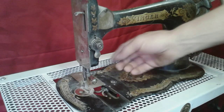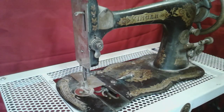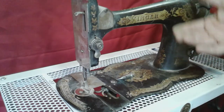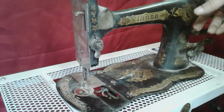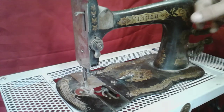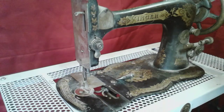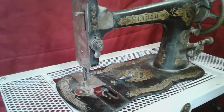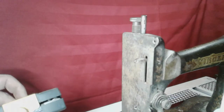The shuttle moves and doesn't look bent — everything's there. I'm going to go get some oil and thread, flip this machine up, oil the spots on the undercarriage first, then hit all the oil points. I'll pull the cover off and get some oil in there too. I'm going to give it a fair shake — just oil everything, no adjusting, nothing other than oil. And maybe new thread on the bobbin.